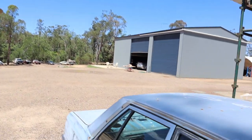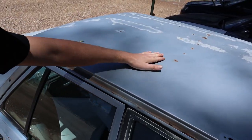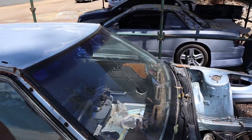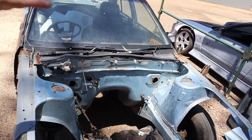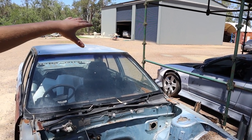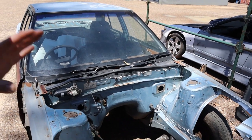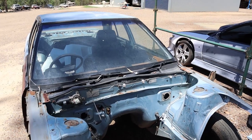I've still got to fix a few things in the roof — I'm going to grind these out and bog up all the rough spots. A bit more prep to do to the actual car before it gets painted, but I've given the engine bay a quick sand and it's pretty much ready. So I figured while we're painting today we'll just blast this, and then once painted I can work on getting the new cross member spacers in, then look at fitting the engine and getting our pipes made.